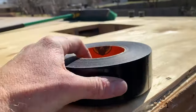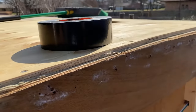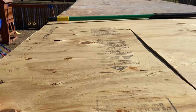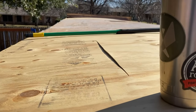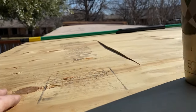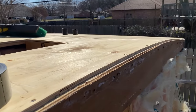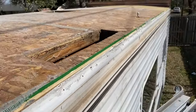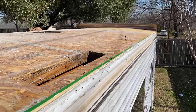I'm actually just gonna use this heavy-duty gorilla tape, and if there's an area that may be a little more abrasive or sharp I'm gonna double up on that. You can see here the remaining portion of the skylight that I have to cut out. I'm gonna start working my way around, get this stuff taped up, and then tape the seams that run horizontally across the roof up here — making sure there are no raised edges, screw heads, or nails that are gonna interfere. I'm just slowly working my way around with the gorilla tape; it's taking a little bit of time but it'll be worth it in the long run.